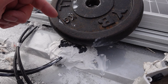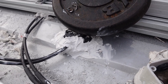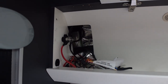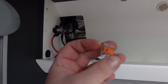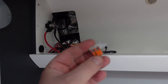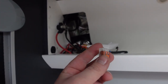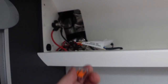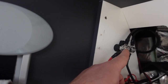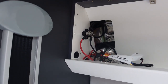The Sikaflex is all done, weighed down to set. I've put extra around the cable outlet to make sure there are no leaks, and it'll set for 24 hours. Internally, I've decided to replace the Adria solar connection - they're decent connections but with solar, the stronger the better. These clamp connections can become loose, and any loose connection on solar means reduced current. Working with low voltage, you want every bit of current going to the battery. I'm putting in a bulkhead wall connector with nut, bolt, and proper crimps instead.